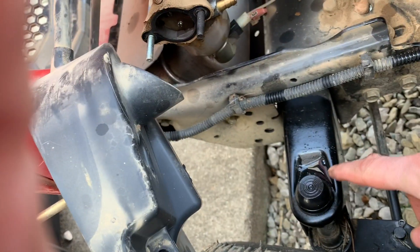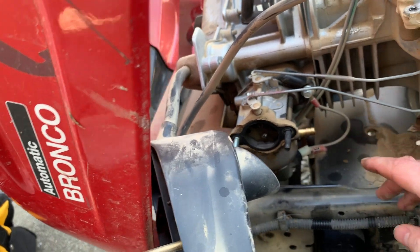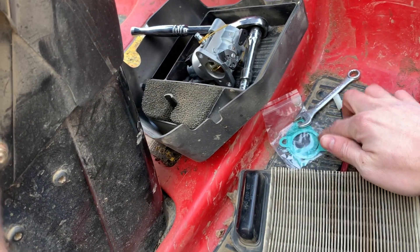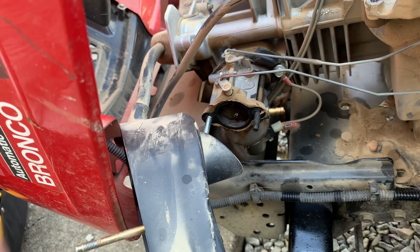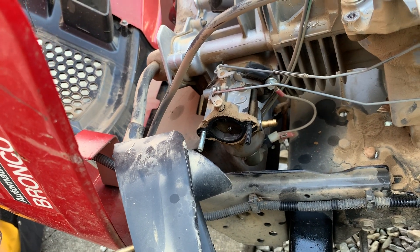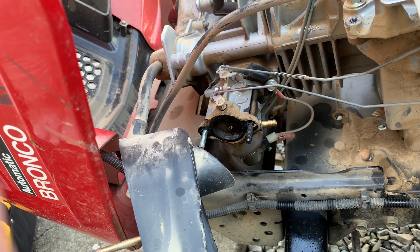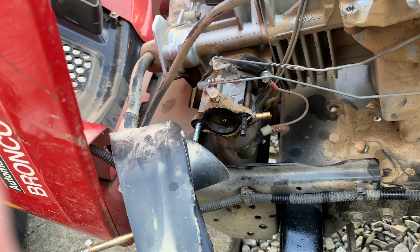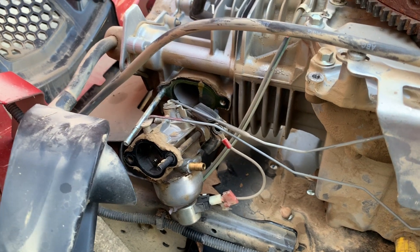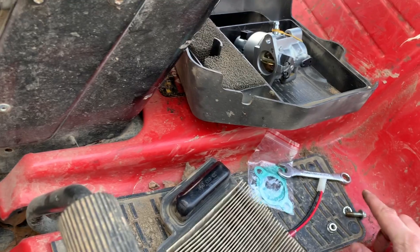I only spilled a few drops, so I did pretty well. The next step is a couple of bolts. The new carb came with gaskets on either side - there's one I have to pry off and one in the back. It should just be disconnecting the old one and connecting the new one. What goes wrong in these is there's a little diaphragm in there and it can get a pinhole in it and cause it not to work properly. I'm not going to rebuild it - I'm just going to put on a new one because it's cheaper than the rebuild kit. It's not held on by anything except pressure from the air box.